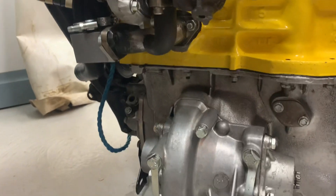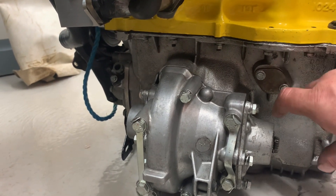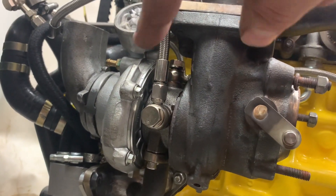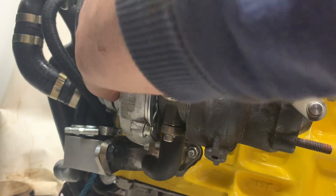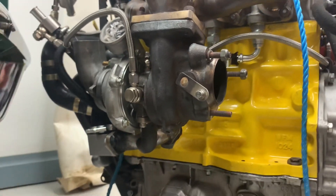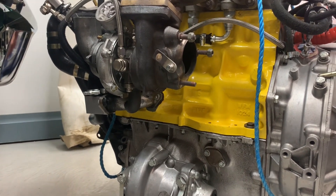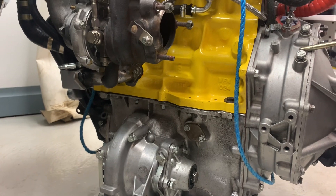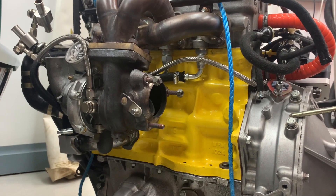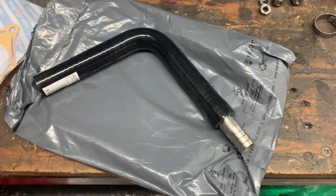There's another couple of things to do — I think the side bush on the driveshaft needs the bronze bush replaced as well. There's a little bit of play in the pot joint so I'll do that while it's out and put a new rubber seal in the end. The bracket for the actuator is going to be getting redesigned and actually welded onto the housing of the turbo. I'll keep you updated with that. Before the end of this project — I think I'm going to call it Project Pottery, because all I seem to do is potter away a few hours here and there.